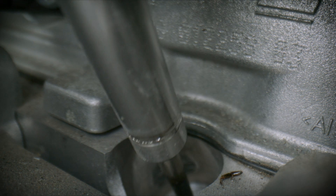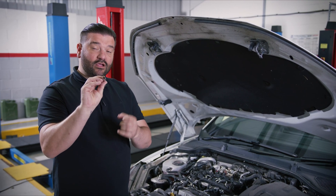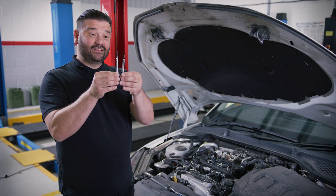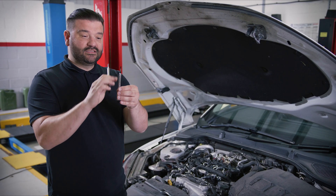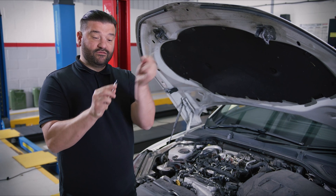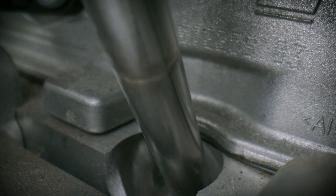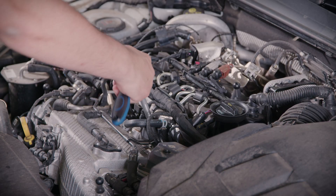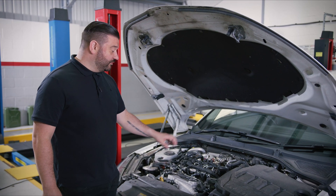We can see that there's no visual damage — we have some black soot at the end, which is pretty much normal for a diesel engine. As you can see from the outside of the plug, we have five pins on it for both the glow plug and the pressure sensor. Let's grab the new unit and get it replaced. We can clearly see the color difference between them. This one's just got a little bit of soot from the unburnt diesel — essentially the hydrocarbons. Before we fit the new one, we're going to remove the protective cap, slot it in, and torque it down. The glow plug with pressure sensor is now in and torqued.